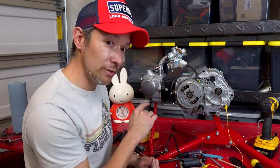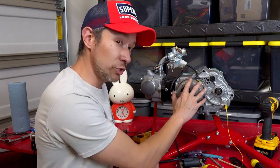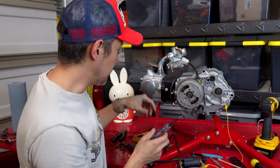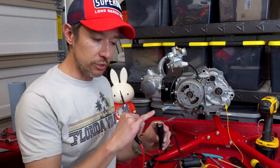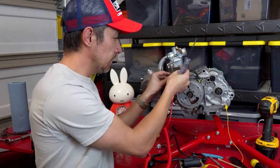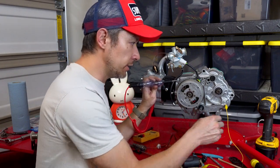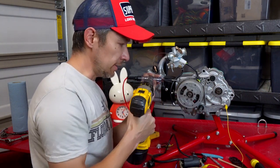In this case I was testing for spark and I wasn't getting it. I tested the coil — the coil was checking out — but what you should do first is check to see that you're getting spark out of the stator leads. An easy way to test that both of your coils are working is to use an automotive test light like this. I built a little extension line here just to make it easier. First, testing the yellow line for the lighting — connect the alligator clip side to the lead, ground the other side out, and either kick over the engine or spin it with a drill.